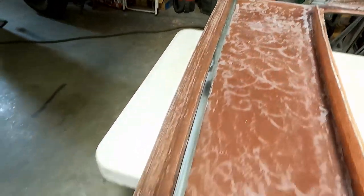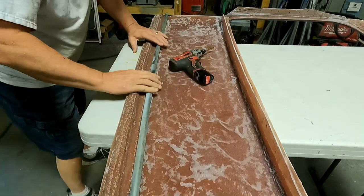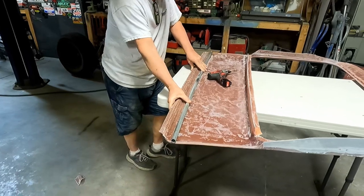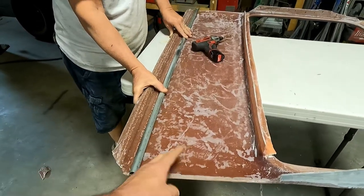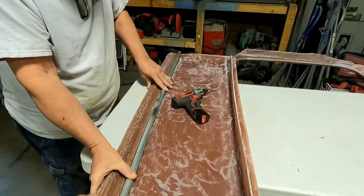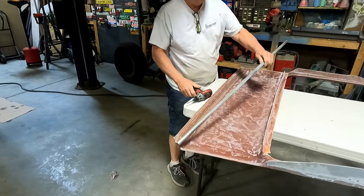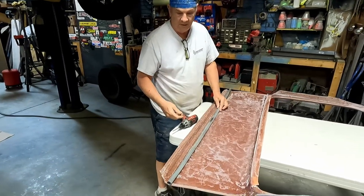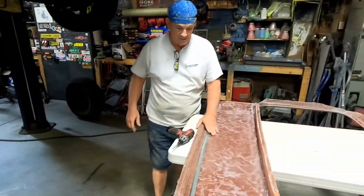All right. We took the pipe and rolled it on that tire over there and got it to be very close to the right dimensions. Yeah, it's close. If we curve it a little more, it gets a little better. So panel bond it, clamp it till it sets up. Then weld this end into the body, and then this just lays on that as we're panel bonding. It's got another piece of steel across that whole length. That should work fine. Yeah, that's just a subtle bend. You know, I highly recommend a real subtle pipe bender. It's right there. It's just a tire.